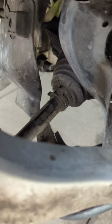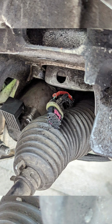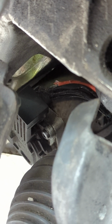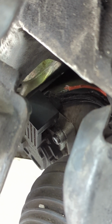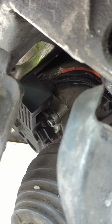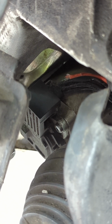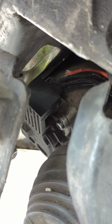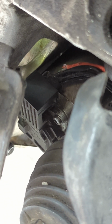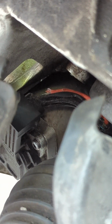The other thing is the wiring loom, I'll put a picture of the fix that we did on it. The wiring loom to the steering rack, and this is the magnetic Hall effect sensor on the bottom of it, tends to degrade over time. So if you're getting 80, 92 and 1444 for the steering angle summation and total steering angle, it could be the actual wiring loom shorting out on itself. So our fix was just to chuck something up the actual wiring loom.